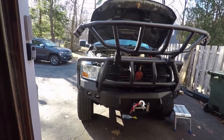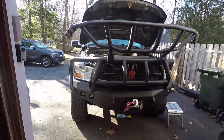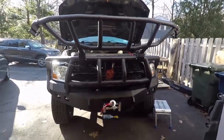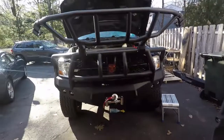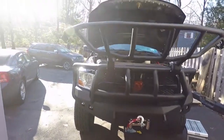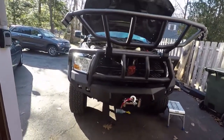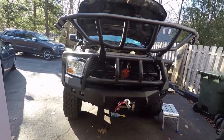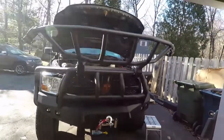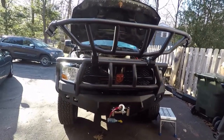I got the air compressor system in. I've wired everything up. I've tested everything. It all works. I've gotten all my leaks sorted out from the air system. The only downside is, and I think this might have been from the accident, the air solenoid valves that make the air horns work, one of them is sticking open after you hit the horns, so I'm just going to order a new set and put that in.